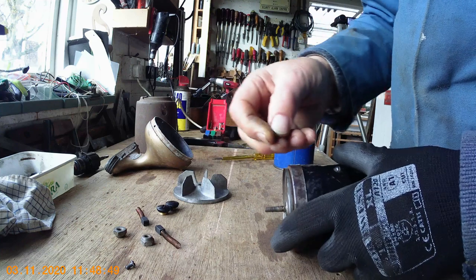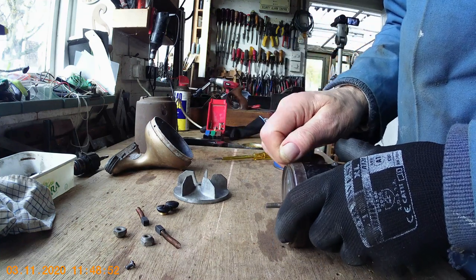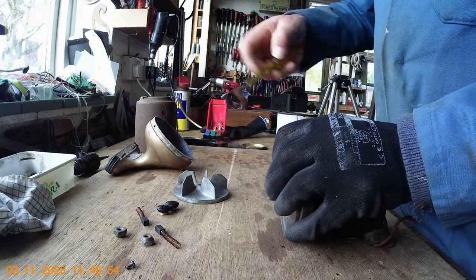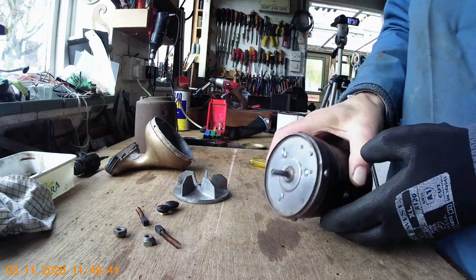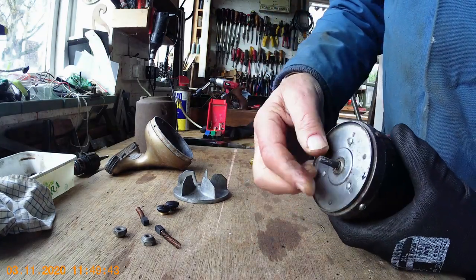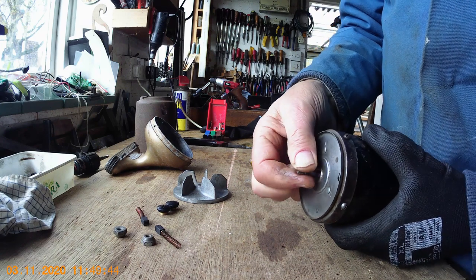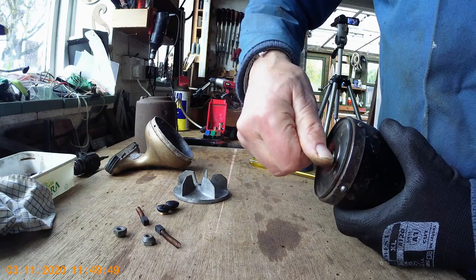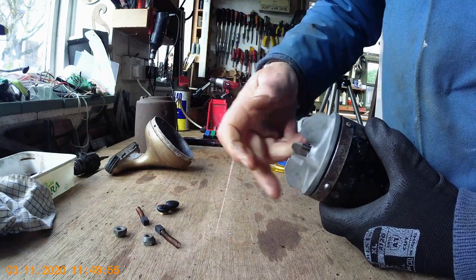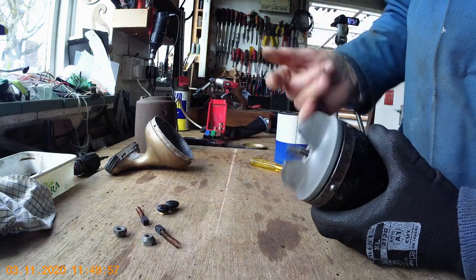It's a matter of putting the screws in around here — there are four small screws. Pop the screws in. I've got the four screws in, tighten them up. Now just check the armature before you do any more and make sure that it rotates freely — which it does. I'm just going to check the fan spins. There you see — the fan spins fine, it doesn't rub on here.